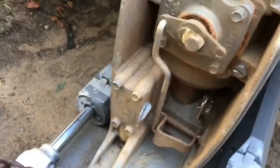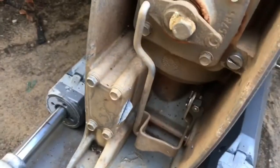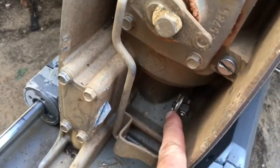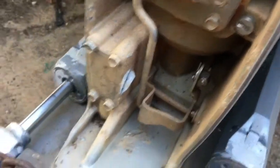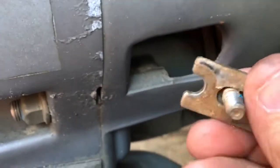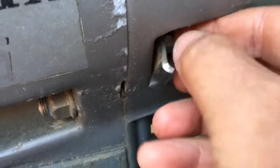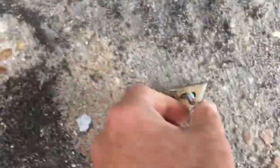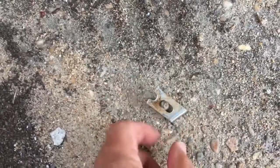I'm at the stage where I'm just about ready to pull the outdrive out. The Volvo SX pin is different than most — there's no water seal at this joint; the seals are inside. So you take this back cover off, and there's a nut and a cotter pin. You remove the nut so the shift cable threads off. It's a pain, but you get the shift cable to slide out. Then you go up in here where there's a bolt.